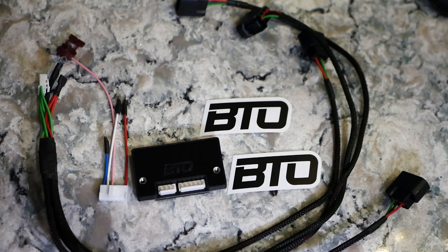I got this because there's another COP kit out there that has a variant of the COP, but it still has the rotor arm that sends the signal. This one — there is no rotor arm. It's literally just an ignition module and the harness. Hopefully it doesn't cause any ignition timing issues, but I'll give it a shot. This is about $200 from BTO. If you have any questions, go ahead and throw it in the comments. Please like and subscribe to my channel for more product reviews and our project EJ6 that we're building. ASG Tech out.